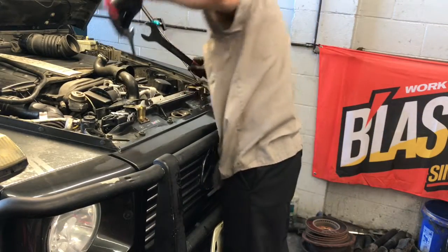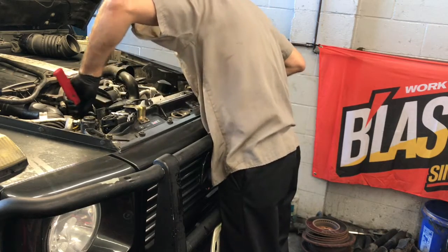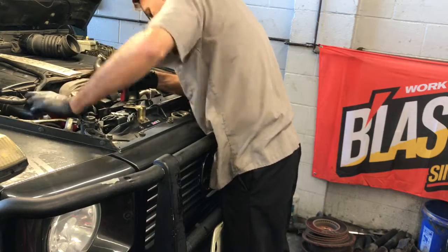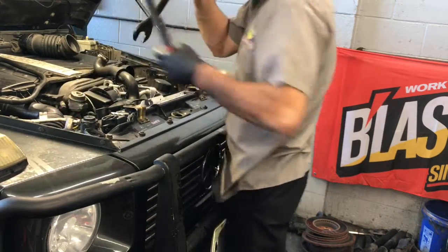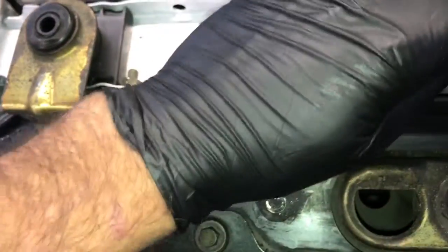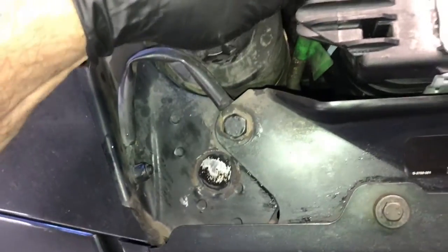You're going to use your spanner wrench, and you're going to basically flip it over. It's going to look like this at this angle here, and you're going to hook it on the bolts on the water pump, and then you'll use the 36mm wrench, and you'll pull clockwise and push the spanner wrench counterclockwise to tighten it up. Now you're going to just double check that the fan shroud is in position right and the fan does not rub, and then you can go ahead and install the 3 clips that held the fan onto the radiator. So reinstall those clips.